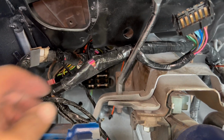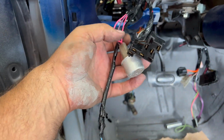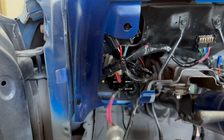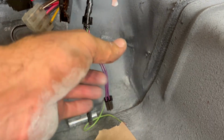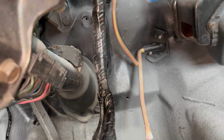Now what's coming towards the front here, these are all kind of flopped down here to the front. But this is your wiring for the wiper switch, of course the flasher, and headlight switch. And of course the headlight switch mounts here, wiper switch right below it. So that's orientated pretty good. Coming across the dash, we talked about those guys here. I flip down here underneath the column. These are both ignition switch, turn signal switch, purple's park neutral switch, and this is your reverse lamp switch, which is here on the column. I'm getting ready to drop that down.